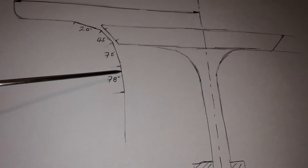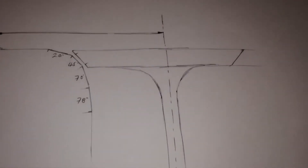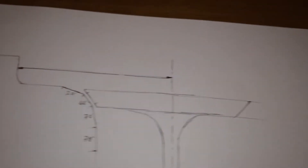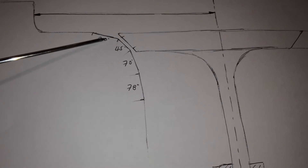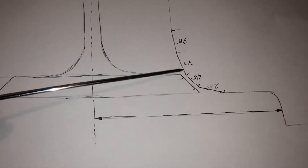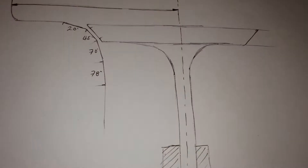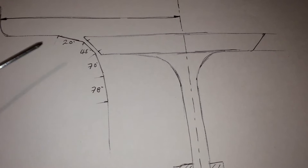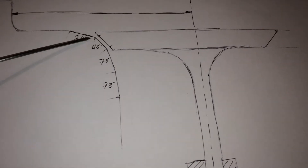The 78 degree non-concentric has been cut off on a different centre to the guide, which is causing problems. As far as terminology goes, most engine builders and machine shops will call the 70 a bottom cut and the top angle a top cut. With the cylinder head upside down on the bench, as it is on nearly all head cutting equipment, when I say bottom cut I'm referring to the 70 or anything below the seat, and top cut would be anything above the seat.